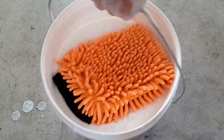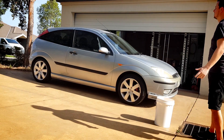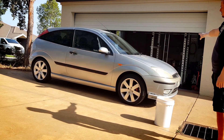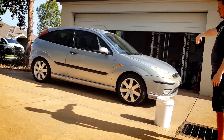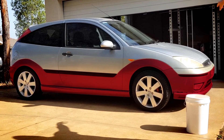These grit traps are quite cheap — only a few dollars each — and it's quite a worthy investment to make sure that you don't end up scratching your paint. I'll leave a link in the description below if you want to pick a few up for yourself. Don't cheap out, make sure you get a few of these to use in your buckets, especially if you're only using the one bucket. Alright, let's get on with washing this car. When washing the car, you'll want to do it in phases: start with the roof, followed by the windows, above the trim line, and below the trim line.